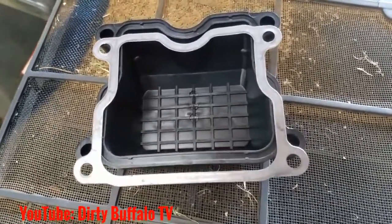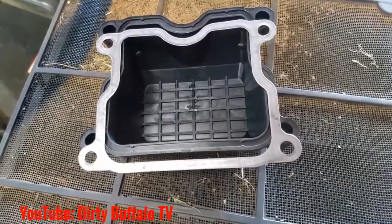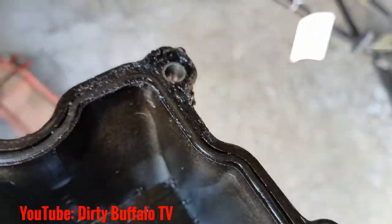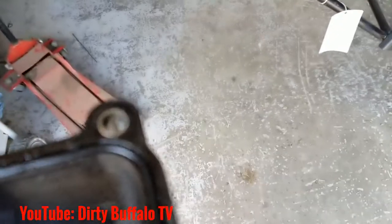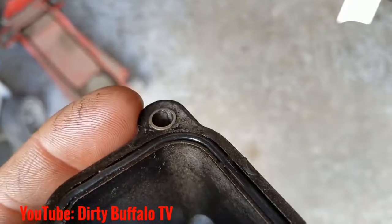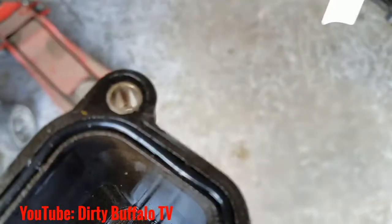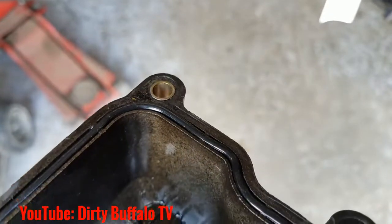It lasts a lot longer than the o-ring does. This is an actual Kawasaki part — the part number for this valve cover gasket is 11061-2199, straight from Kawasaki. As far as valve covers go, obviously you can see that when there's a bad one the corners are all melted up, but if you have a spot like this right here — you can see that lip right there that formed from heat.